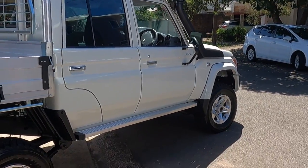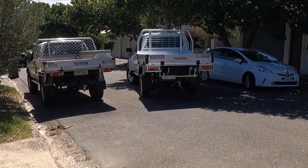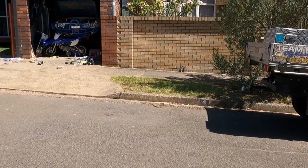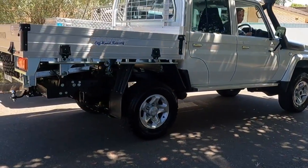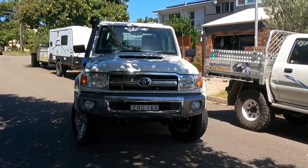My lovely assistant will relocate the car. The springs look like they're going to flex a little — they look soft, it feels soft too. Hopefully they're not soft when I put load on them. Been driving that for so long now you just forget how big a beast these things are — and throw three inches at them. I say you forget how big they are — it turns like a boat in the sewer canal. Because it's still got the stock damper on, we'll get the better damper that gives a bit more lock. Top end feels nice — 80 ks, just on 1500 rpm and that's on the factory wheels, so a bigger tire will drop that even more. The alignment and suspension all feels good.